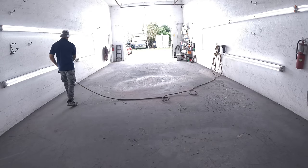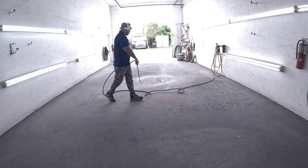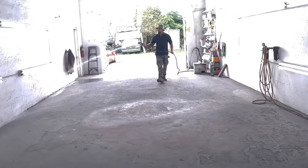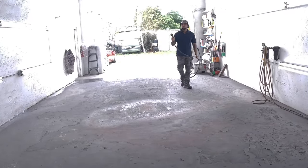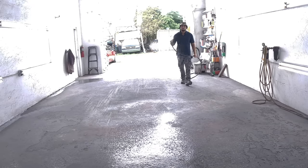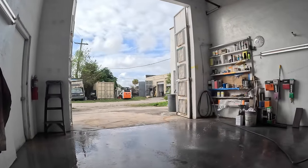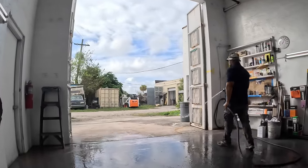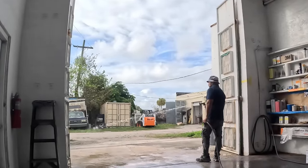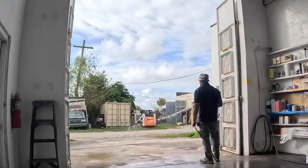These are just a few of the things I've learned along the way painting inside of this booth. Prior to me coming to this shop, I had never sprayed in anything like this. I've seen them around, different friends of mine had worked in them, but I had actually never sprayed inside of one of these booths. Even the whole turning the car to one direction — like if your exhaust is coming towards the back of the spray booth, a certain way you have to position the car. You're doing the rear bumper, you could back the car in so the rear bumper is facing the rear of the booth. I only sprayed in a downdraft spray booth before.